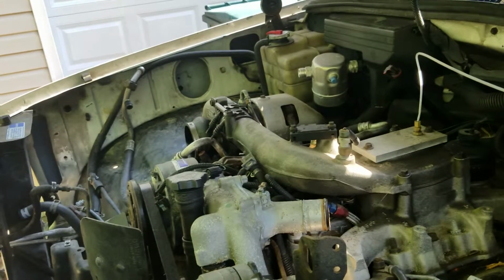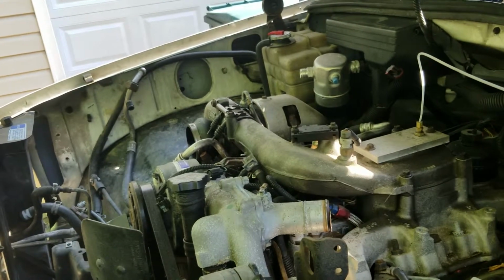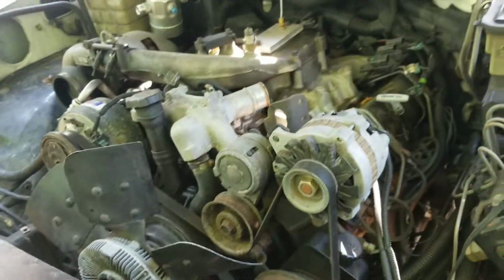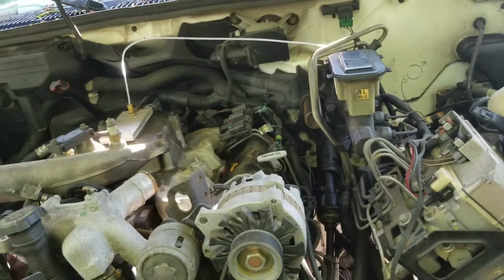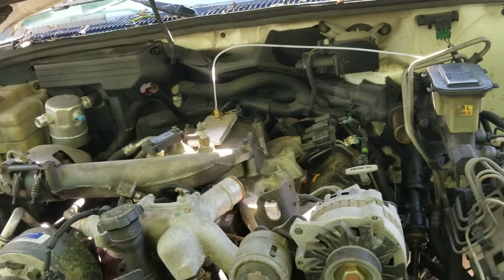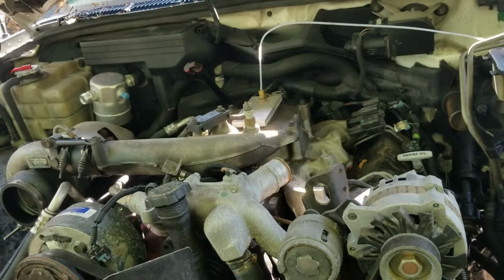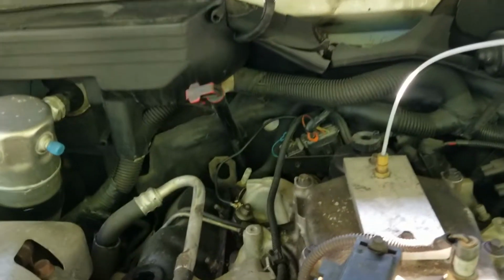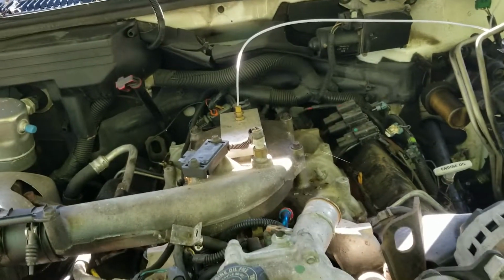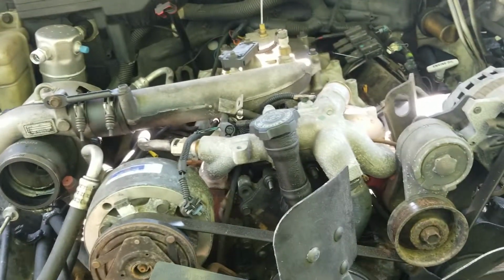I believe there was a Buick diesel early on that was actually a modified big block, but this was a purpose-built diesel platform. This is the same engine that they ran in a slightly smaller displacement in Humvees. The military, I believe, still uses this platform. However, the manufacturer of the block and some of the subcomponents have been reworked over the years, as a result of them finding failures, everything from cracking main webs to scoring on the cylinders, which is also typical. Typically the number 8 cylinders, or the cylinders back against the firewall, will get too hot. They've done some cooling improvements on the new blocks, but the problem is those are expensive. You can buy a short block for those, and I think they're like 10 grand if you can get one.